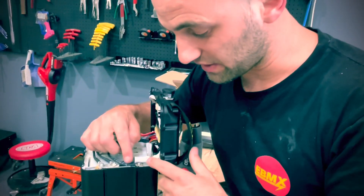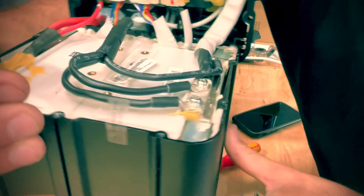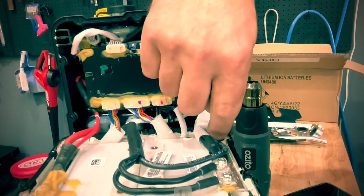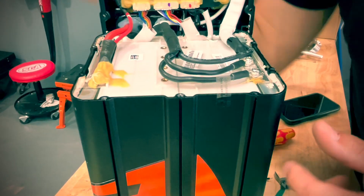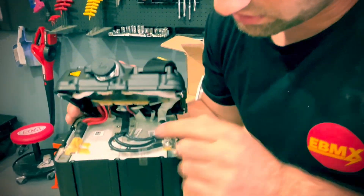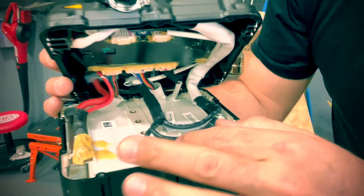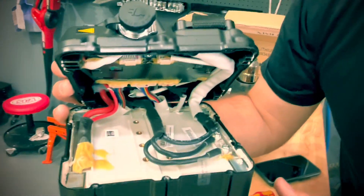This is the arrangement I did. I tried to run this wire from the other side, but because this lug — if you look at it from the front — it's offset, so you really have space running from the outside here. Just curl it like I did here. It works because depending on the way you put this wire, it wants to send the wire that way as you close it. So that's why I curled it — I just did some bends here so it doesn't send the bypass wire all the way in and bite into something.